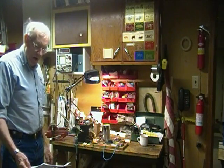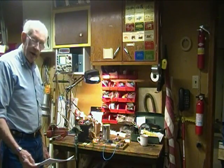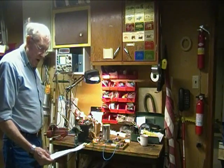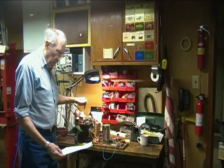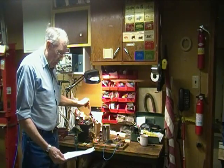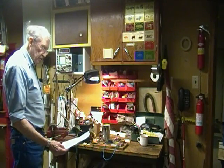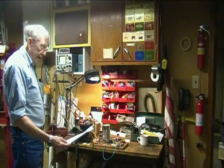The big deal for today is that I am now able to adjust the coil trigger length from 1 ms up to 8 ms. I am doing this to see what the optimum charge time is for any given coil, be it coil-on-plug or not. I have added a low ohms resistance of about 0.1 ohms in series with the power ground to the coil-on-plug pack — not to the signal ground back to the Arduino. With the oscilloscope, I can see the coil primary charging current wave shape, and increase trigger length until the waveform starts to exhibit a flat top, telling me that any more current flow will only heat the coil without adding to performance.